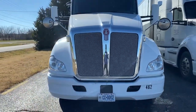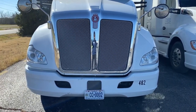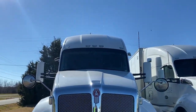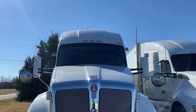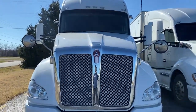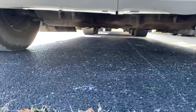The first thing I'm going to do is look at the front of my truck and identify the daylights, the high beams — lenses are not cracked or broken — my right turn signal, left turn signal, four-way flashers, not cracked, clean, not broken. I'm going to identify that my clearance lights on the top are not broken, cracked, or missing. The overall front of the truck is clean, no bends, no cracks, everything looks intact, license plate is present. Then I do a quick look under the truck to make sure I don't see any visible puddles or leaks.